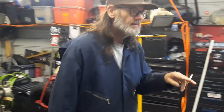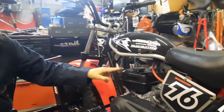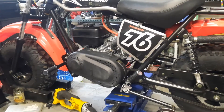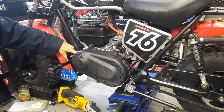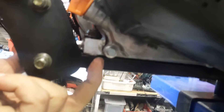Something you need to be aware of: if you're going to try to put a Predator motor, or any of the engines that have a 2½ inch long ¾ shaft in them, you're going to need to get a motor plate and shift this motor over at least an inch.